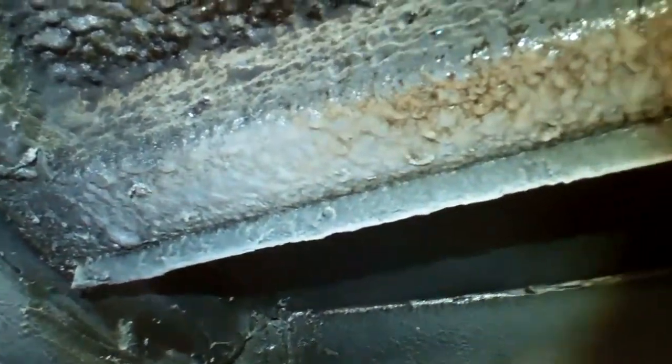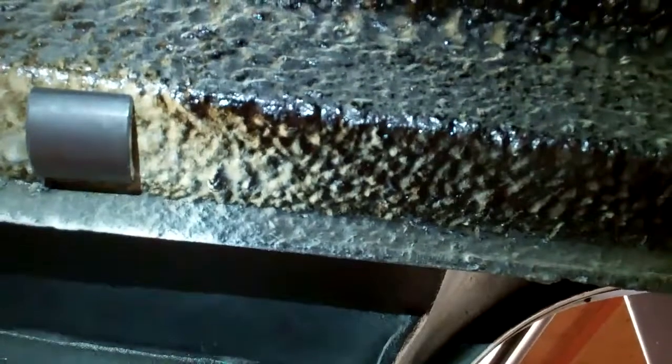The magnet is just to show you that it's not just covered up with body putty — there's actually metal there. I've seen some patch jobs where they actually rivet the body together just to make it look presentable, and that's not what we did. We actually took the time, sanded the panels, removed all the rust, then used etching primer — a really strong bonding primer — to make the paint adhere to the body, and then undercoated the area so it wouldn't get rusty again.